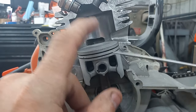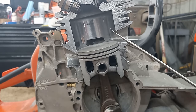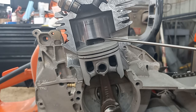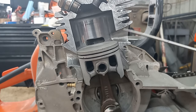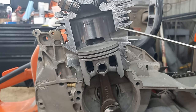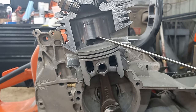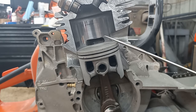Going the other way — say this was already at 102 exhaust roof, which I like, but I've only got 15 degrees of blowdown. I will cut the chamber, cut the base, lower it all down, and then raise the exhaust back up to 102 without touching the transfers, and I gained blowdown. Every saw I've worked on has responded well to more blowdown — I've never had one that didn't.